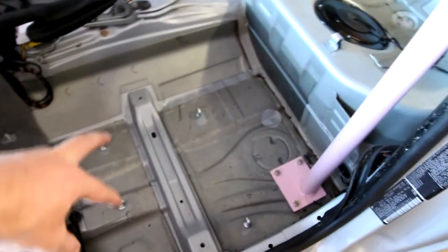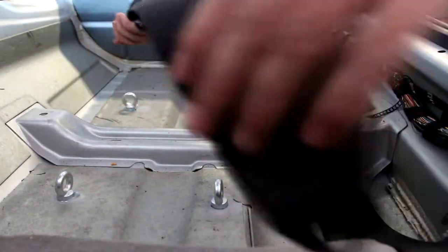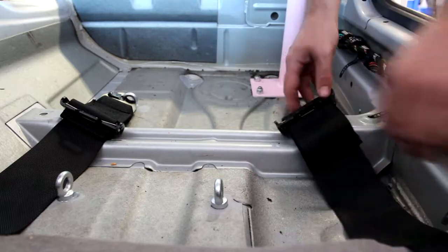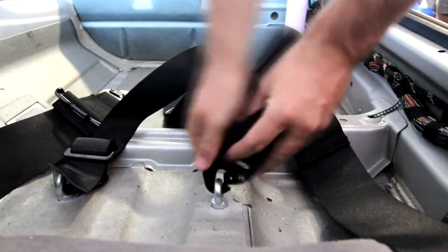Now I've got all the eye bolts in there — they're pretty sturdy, they ain't going anywhere. It's also time to move into the bar, but in order to get that one mounted properly, it's best to have the seat in place. We're going to clip in these ones, reinstall the seat, and then fit the bar-mounted ones up so they're proper in position as well. With the seat back in, I can run these through the little holes to the center. Now it's time for the anti-submarining belt, which clips in just under here.